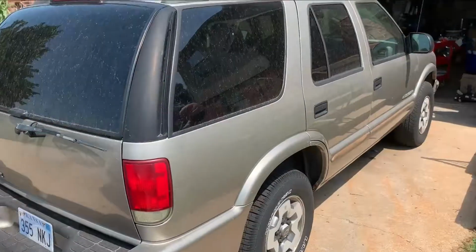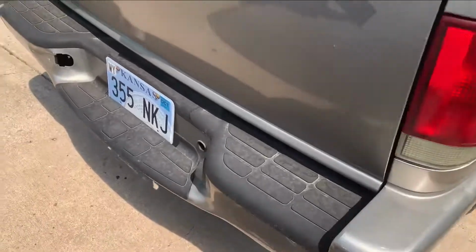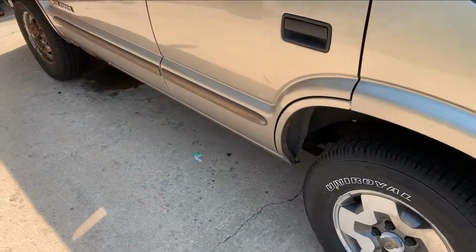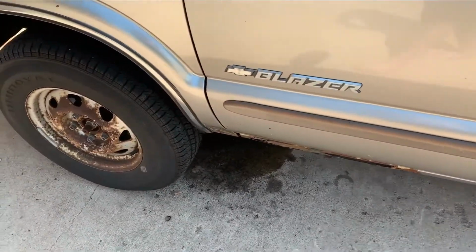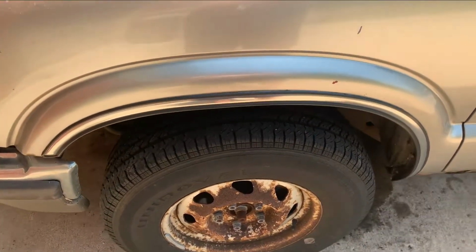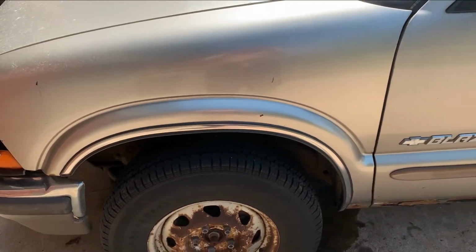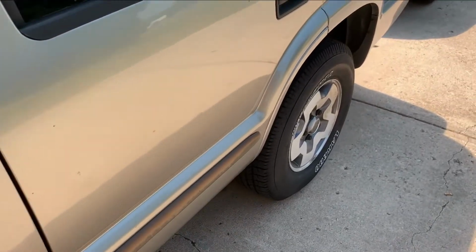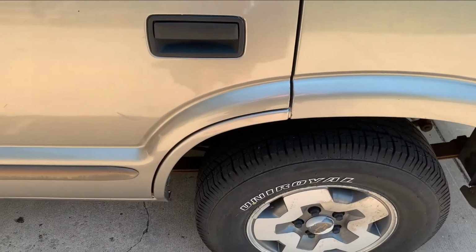The next step, I think, is to actually do the same job I just did on the Blazer, because its suspension is trashed, but that's going to be a full underneath suspension job. Pitman arms, idler arm, the cross-link, sway bar, everything's going to have to be redone on this. It is just absolutely terrible. And I'm thinking I'm going to keep it now that I have the project truck to work on. I need something to run around in. And then when the project truck's completed, I don't want to drive it around in the winter, and this is a viable four-wheel drive, so I'm going to keep this one and put some money into it. That may be the next video I do.